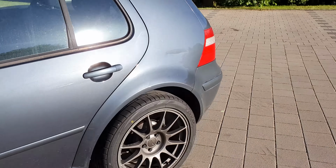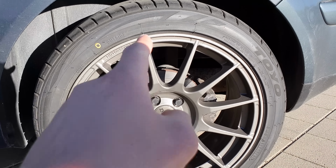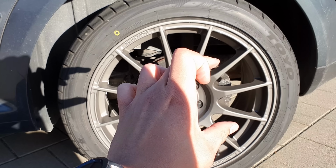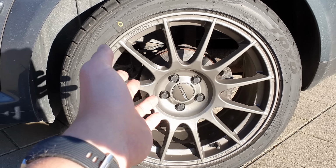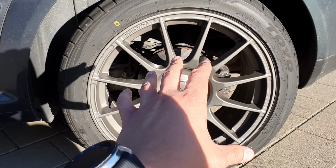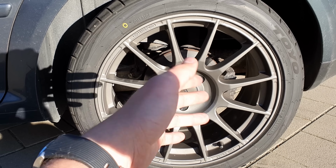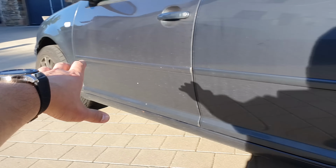Another issue is that we did not get the right rear brake discs together with the pads. Philip did order the big brake calipers for me, but the pads and discs were coming from elsewhere. So the sizes got confused, and we didn't install the big brake kit, which is, I believe, from the R32 Golf and the 3.2 Quattro TT, the bigger size, just to compensate the balance.